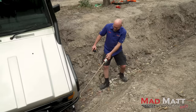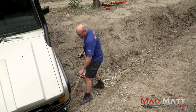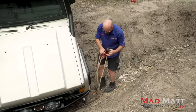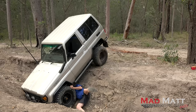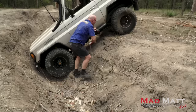I'm going to feed out a bit of slack. I need to get enough to go under the car and out the back. And then what I've got is a tree up over there that I'll use as my anchor point. Just a tip - you'll notice I haven't got the engine running, so I'm just using battery power. So never use too much or you'll have a flat battery. That's cable now under the front diff.